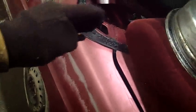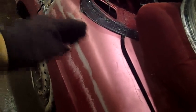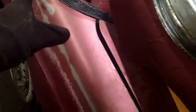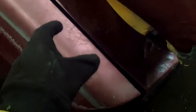So what I am going to do this year is put a big notch towards the far back, or semi-big, like 4 inches, and then I will be putting a 2-inch notch where I have it behind the lid of my trunk where it's tucked. And then I will be pre-bending the frame up just a tad. I'm going to hope that will help with the car folding in nice.